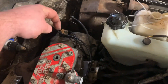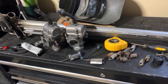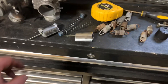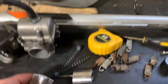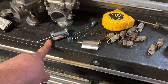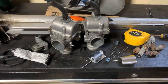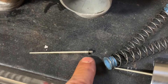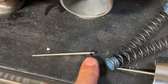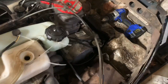Coolant pump plug installed, oil pump installed, everything is primed and good to go. I went through the carbs and cleaned them up. Unfortunately the biggest main jets I have are 180s, which are still leaner than stock, but I have the richest slides I can find. I'm also making my needles as rich as possible — the dealers are closed so I can't buy jets today, but I will buy larger main jets. I've got my clip in the lowest position on the needles, which is the richest setting.